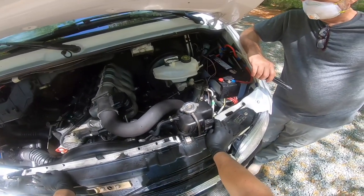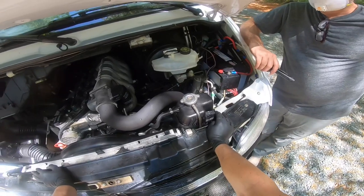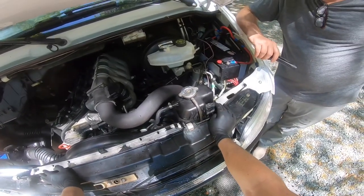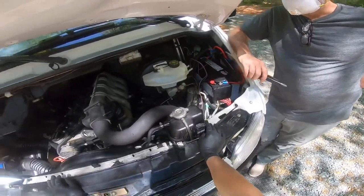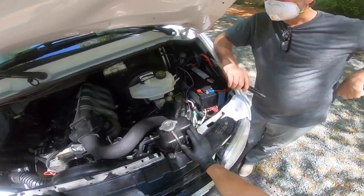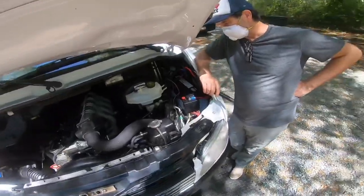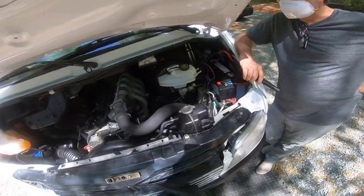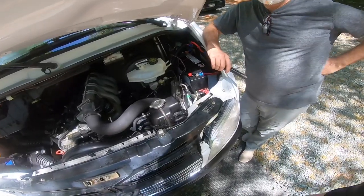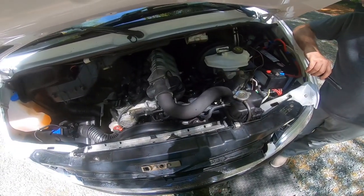The worst that could happen is after a while the spring becomes weaker — sometimes they can break. I've never had one break personally, but after a while the spring becomes a little weaker and doesn't keep good tension, causing the belt to slip off, even from little splashes of water. It was raining hard and I passed through big areas of water — some splashed underneath and caused my belt to slip off twice. My tensioner had gotten to the point where it was weak. As soon as I installed the belt back on and hit another pothole, the belt came off again. Very easy for it to happen.